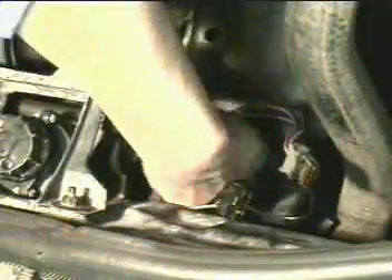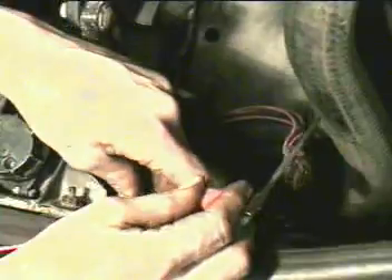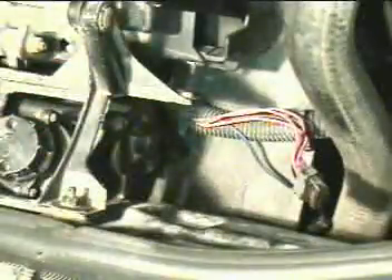Find the blue wire that is going to the motor. Now I'm going to probe the red wire again and the motor should go down. I've got a good connection. So by this test, my motor has checked out correctly. The only link there is the motor relay, so I have to assume that the motor relay is bad.